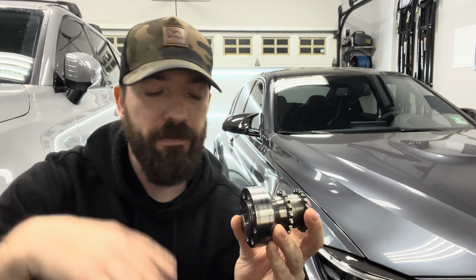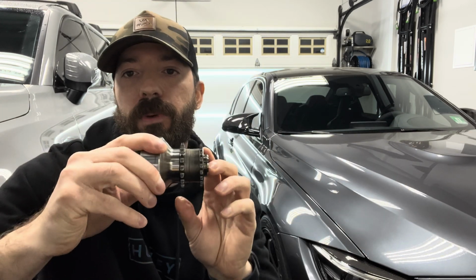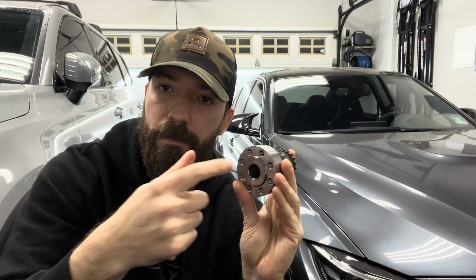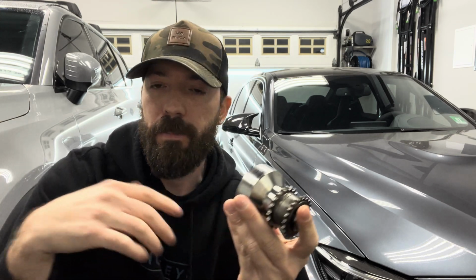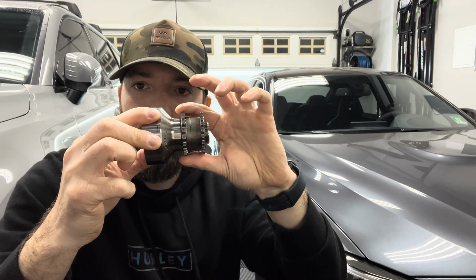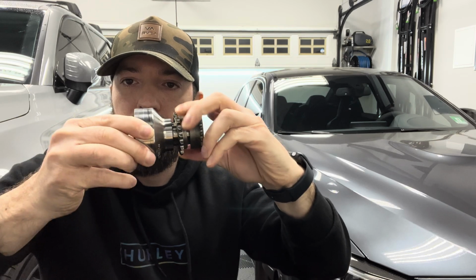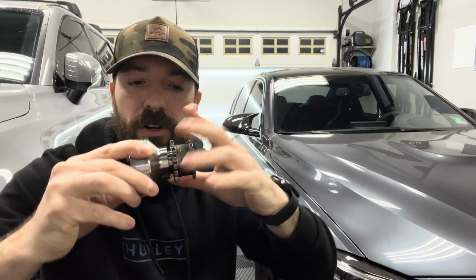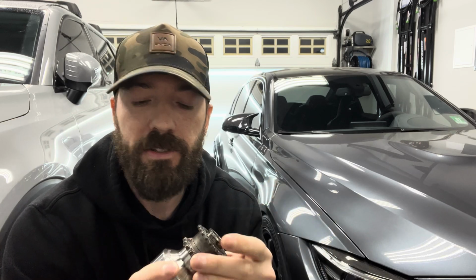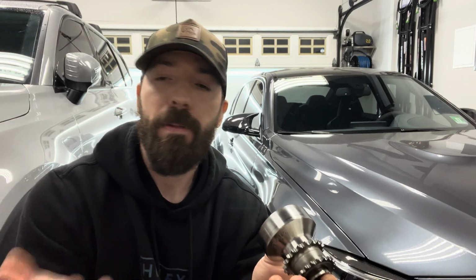So when this is bolted up to your crankshaft, everything is spinning, this hub is moving. These gear sets right here should be moving at the same speed and pace as your actual hub. But what can happen is the bolt going through here can loosen up over time based on vibrations, how you drive, that kind of stuff, and can move. And these gears right here can slip off and this can spin while these stay still or vice versa. This can spin faster, what have you. These all need to be spinning at the exact same speed. And if that does happen, the worst case scenario is a catastrophic failure where you get bent valves and obviously pistons and rods and stuff like that would not be good. The better end of it is that it just goes out of timing. You shut the car off quickly enough and all you got to do is get the car retimed and you'll be on your merry way.